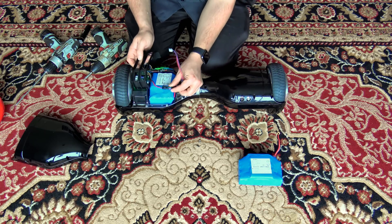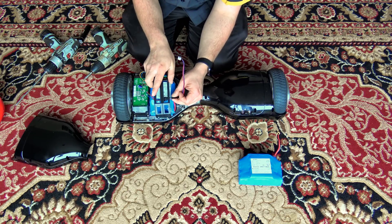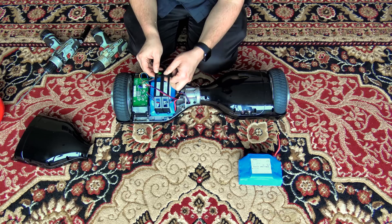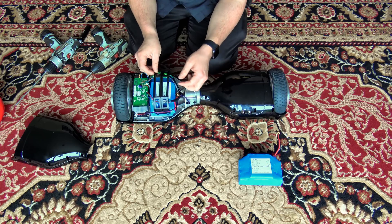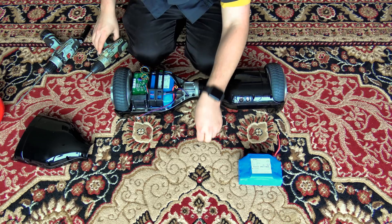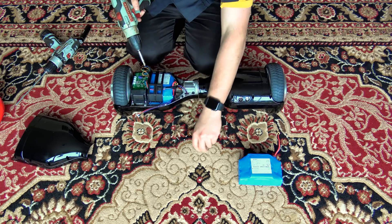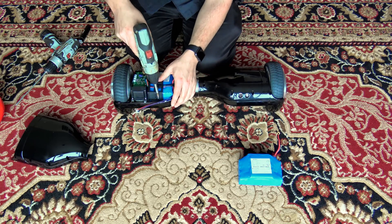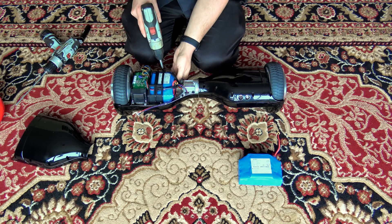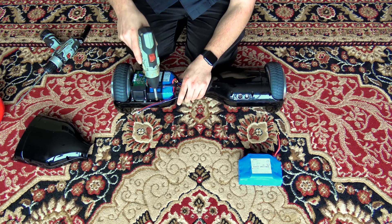Take your retainer. Now, if yours has these black clips with the little lip on the side, they actually clip onto the battery retainer — it helps keep the wiring from moving around too much, especially with how much abuse these little things take. Line up the holes for the screws and put your four screws back in. I recommend not tightening all the way yet — do one on each corner across from each other. That holds it steady and lines up the other two holes. Put the last two in snug, and then snug the other ones.